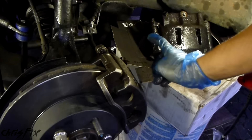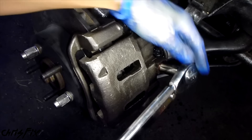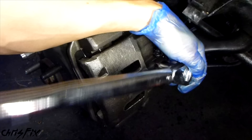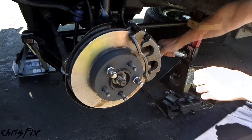With the brake line transferred, we can get the caliper and bucket setup out of the way to make more room. Before we do anything else, let's torque this down. On my truck, the banjo bolt gets torqued down to 25 foot-pounds — with both copper washers on, this torque compresses the washers against the surfaces making a nice solid seal. The caliper bracket bolts on my truck get tightened down to 85 foot-pounds — torque the top one and then the bottom one.